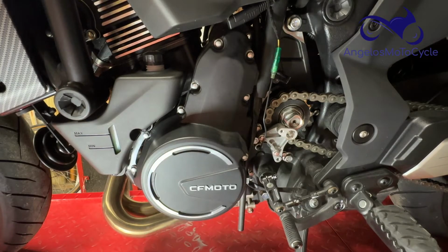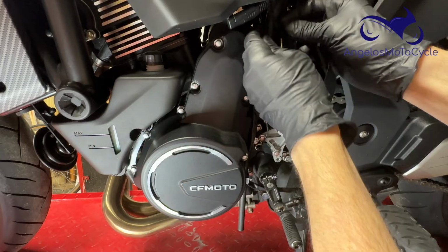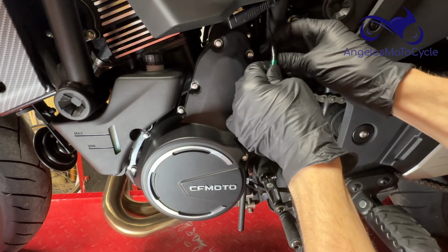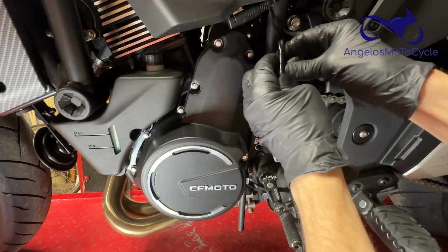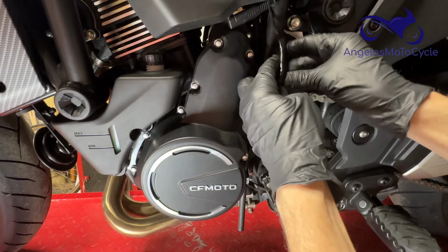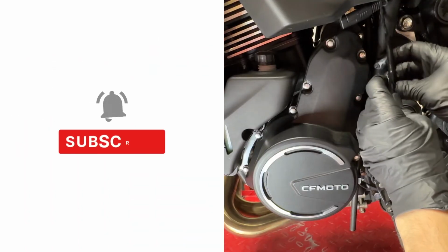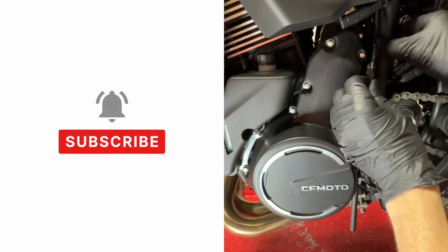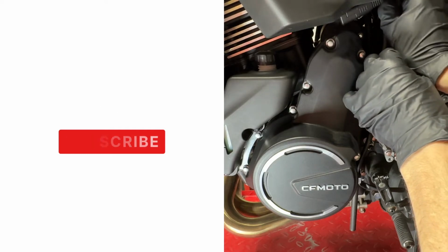And we'll get some electrical tape. And we'll wrap it just the same way it was from the factory. They're probably just being cautious about any water getting in there. Obviously, you don't want water getting into your sensors. It'll cause malfunctions. So they chose to use some electrical tape. I figured if I just duplicate exactly the way it was, then I'll be okay. All right, there we go. And we put it back inside this black tube.